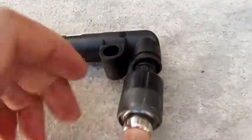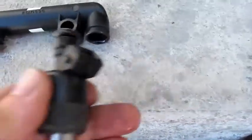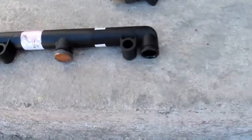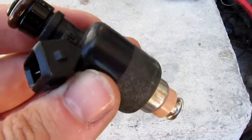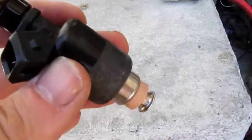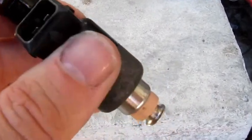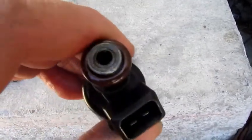You could use a clip here — I don't because it saves time. You want to have safety glasses on because sometimes this will surprise you — it will pop out, get slippery or whatever, and pop out of the fitting. If you've got your air pressure plugged in, it'll just start blowing everything out and you'll have a mess. As I triggered it, it sprayed gasoline, because there will always be gasoline trapped in these. If you put gas in this end, it will not come out the other end — there's a simple valve and a spring. When you trigger the injector and turn it on, it opens the valve and you get a continuous spray pattern. Hit the switch and turn it off, the spraying stops.